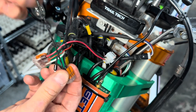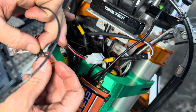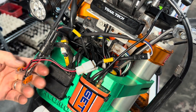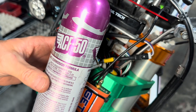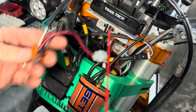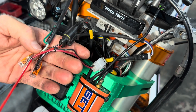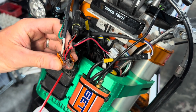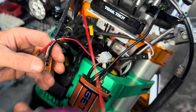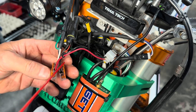Close it and you're done. You can really quickly add an accessory item to any of the electrical systems on your bike. The last thing that we always do is we want to corrosion and waterproof these out. We've found in practice that the best thing is ACF 50. You can get this on our site, and a spray of this into the ports, into any of the open-type connectors, will prevent corrosion and inhibit water. This is a really fantastic item and we advocate for it. When you get a new bike, you would do well to prep it out by putting this in all those connectors.